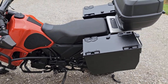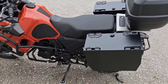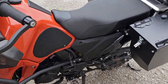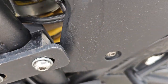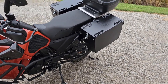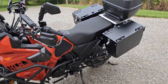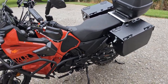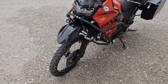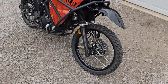The chain is stock. For suspension, I have upgraded the rear coil spring — it is the Top Gun 8 kg spring in there. I have it set in the middle of the preload, so there is adjustable preload. The front forks have progressive replacement springs installed to prevent nose dive.